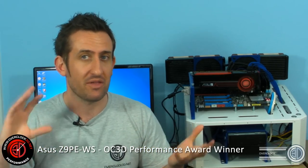This should give you something to think about regarding other dual Xeon boards coming later — gone are the days of these being the fastest gaming systems you can build. If someone asked me for an amazing gaming rig recommendation, I'd tell them to get the Rampage IV Extreme, which is still the best 2011 board for gaming. The overclocking limitation isn't an Asus problem — it's Intel locking the Xeons down.